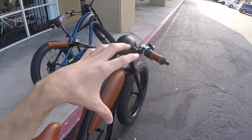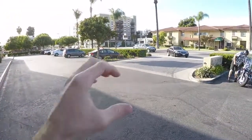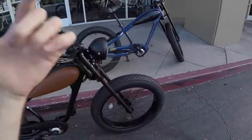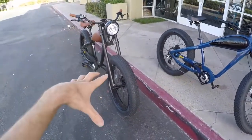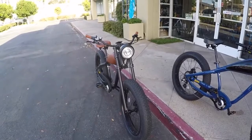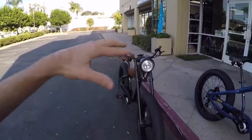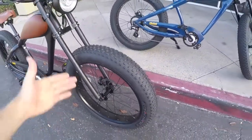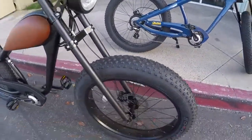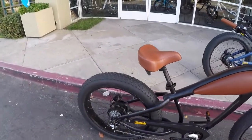That light is a centerpiece for me. This is also a comfort bike — these bigger tires give you good vibration dampening; you span the cracks a little better. I frequently call these out as sand and snow ready because you can lower the tire pressure and handle that. This is about a 75-76 pound bike — a little heavier than listed on the website. They could have shaved weight with punched-out rims, but these are sturdier. We've got 13-gauge spokes front, 12 extra-thick rear, 36 spokes versus 32.